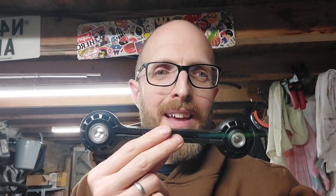You'll see people join anti-roll bars to a car with drop links with all kinds of adjustment, but for ease of replacement and simplicity, we've gone for a really bog-standard set straight off the shelf. These are Audi A6 drop links — the plastic ones. They're half price and super light. The aluminium ones are about £60; these are about £30. Dead simple. Audi A6 drop link. You're going to need to bolt this to the anti-roll bar, and you can get Audi A6 drop link bolts — not very expensive at all.